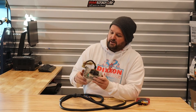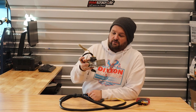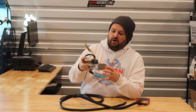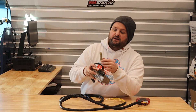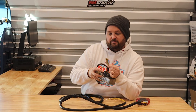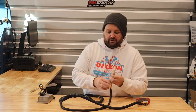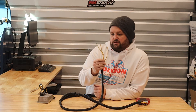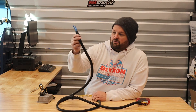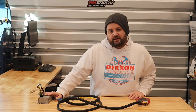We'll look closer on the ATV, but right here on your module — whether you have this newer version with a harness sticking out or the older version that's a black box with three male terminals sticking out — that's what you end up with here on the wires. This is where you will disconnect the harness from your stator on the vehicle. You'll just unplug this and leave it hanging, no longer needed. Your three yellow wires from our harness will plug into your stator, which we'll show you on the ATV. You'll route the wires to your battery, and it's that simple. That bypasses the internal voltage regulator and gives you a really reliable conversion for your charging system.